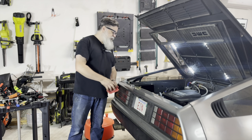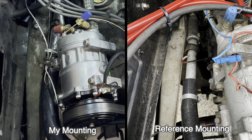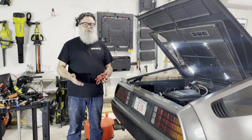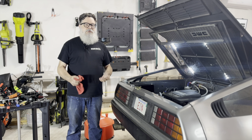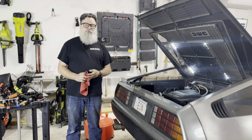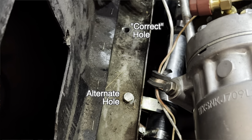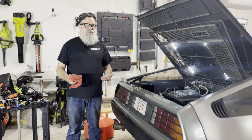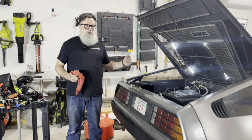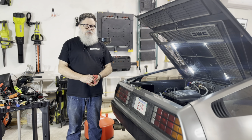The other problem was the location of the cushion clamp. There's a hole in the frame where it's supposed to mount, but when I used that the pipe rubbed against the frame — right back where I started. If I adjusted it slightly, the hose rubbed against the frame instead. I don't want anything rubbing against anything, so I made use of a second hole in the frame, a little further toward the back and toward the engine. I don't know why it's there — maybe an early car thing or a previous owner's modification — but it's perfect. The hoses and pipes all clear the belts, the frame, everything. All I have to do is fill it with coolant and take it for a drive.